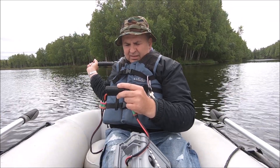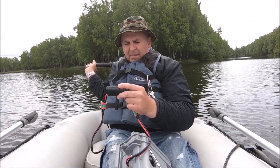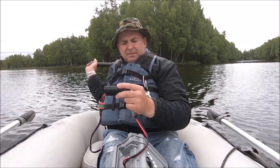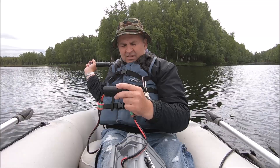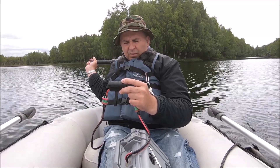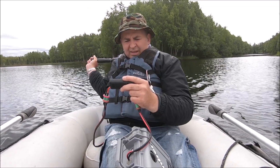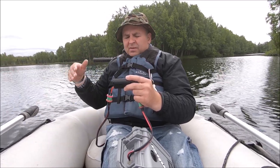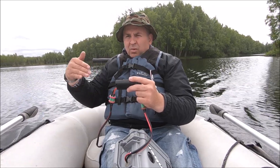Now since we've reached full speed on second gear it's showing 10.1 amps. Third speed now is showing 14.7, 13.9 amps. When I shift to third, fourth, or second gear, since the boat hasn't reached full speed for that gear, the initial reading is going to be quite high.